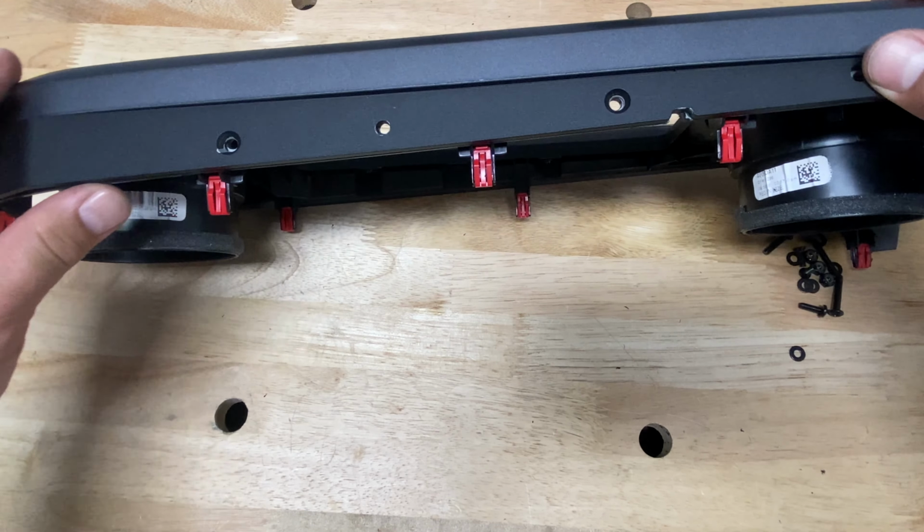Next step, we're going to remove the radio bezel, and again, added pressure should come right off. Now grab your 7/32 inch bit and go ahead and do your drilling. And with my channel locks, I'm going to go ahead and squeeze that brass insert to the bottom. And now I'm going to put everything back in reverse order.